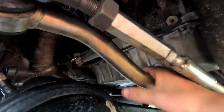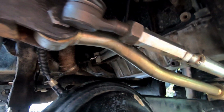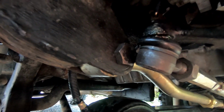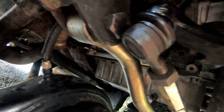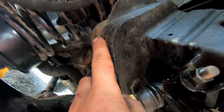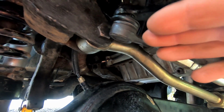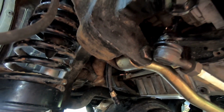Now the Panhard rod, I got that brand new off eBay. It's a Land Cruiser 80 series, and the only reason I got the 80 series one is because this was the cheapest adjustable one on eBay. I think it was like 88 bucks or 90 bucks or something. And the Panhard bracket, that was just made up. We just made that on there at the time, which is out of 5mm plate steel, and then I think it's 4mm flat steel that we heated up and bent round to give it some strength through there. And it's actually on the other side. It's got, how do I explain it, like a plate that goes up and wraps right around the chassis rail. So it's not just welded on the outside. It's actually fully boxed and braced right around the chassis.